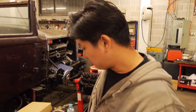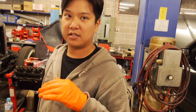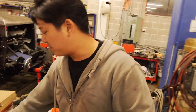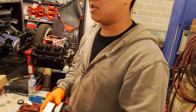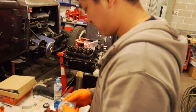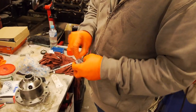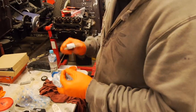You're saying that the standard bearing is 35 on the dot. The standard bearing is 35 minus. So it can be 35 or slightly smaller than 35. That's the allowable tolerance. What's slightly smaller? For something like that, it will be maybe at max 5 microns, according to DIN ISO. So this is the one that goes on there, and I'll just have a measure. So even though it's zero, it doesn't necessarily mean it'll be size for size when you take into account tolerance stack.